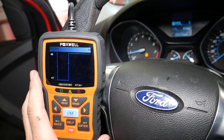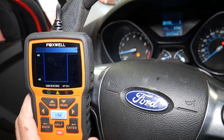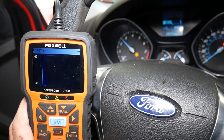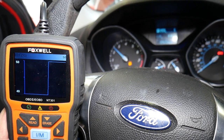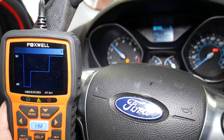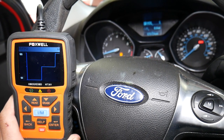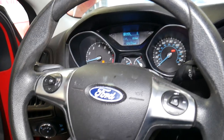Make sure you do not overheat your car. In Celsius, if it goes over 100 degrees — even a few degrees over — shut it off. In Fahrenheit, that's about 210 to 215 degrees. Now rev it up again at about 2500 RPMs for another 30 seconds. You can see the coolant warming up, which means most likely we don't have much air left in the system. Remember how we removed that hose — we probably got almost everything out. Do that five times, then I'll explain what else you need to do.